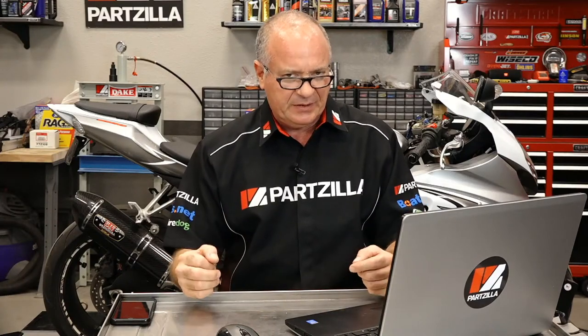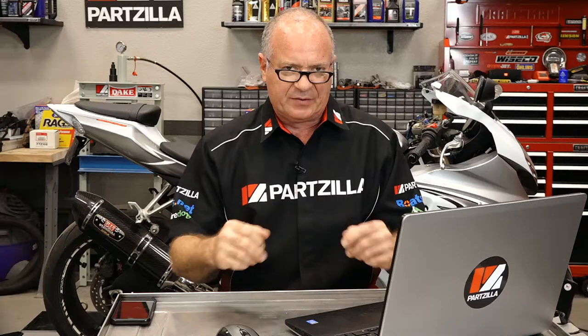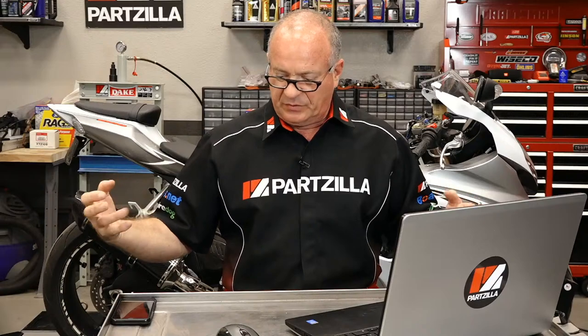I've also seen them at a couple of different auto parts stores, and I believe they have one small enough to get down to the size you're talking about. Now, they're really made for, you know, like a car type drive shaft with the U-joints. But I think they make one small enough to deal with your application. So once again, it's just going to take raw pressure to push that through.